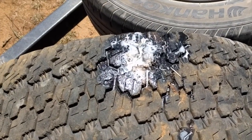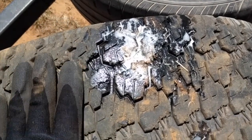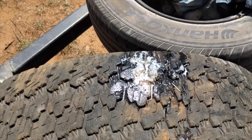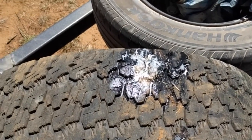Sorry for the wind, but I just sprayed where the hole was, where the puncture was, and now there's no air coming out. So I think I've sealed it. Now I need to put the tyre on and run it around for about 5–10 minutes on the car just to make sure it's sealed up properly.